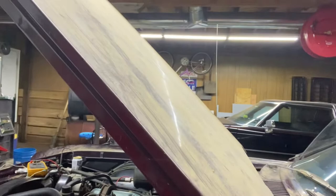Anyways, I'm gonna turn this around so you can hear it, but when you press the horn button, probably terrible to hear, but you get a high pitch whine. That means that is working. That means that relay is shot. I jumped negative to that relay, confirming it is shot, which means the first junction point right off of the battery is shot.